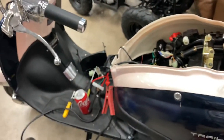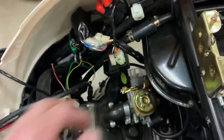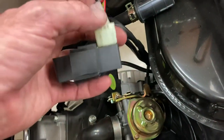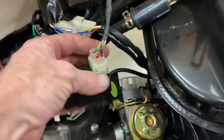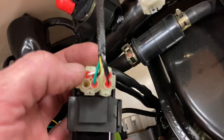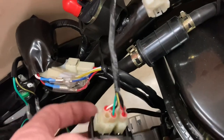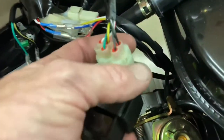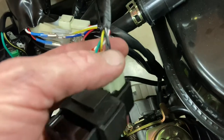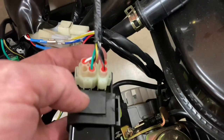Let's find out what's going on. I've got my CDI here — this is my OEM original wire harness. CDIs you can't really check; they either work or they don't. So your top right is your trigger, about two volts. This is your ground. Your yellow and black goes up to your spark plug coil — very high voltage. Down here you have your AC volts coming in, which should be over 50 AC volts. Top right is going to be all your kill switch stuff. We don't have any spark, so we need to find out what's going on.